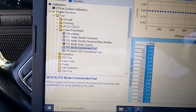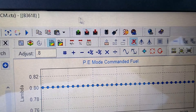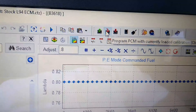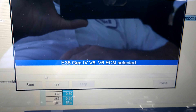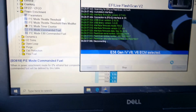So first, get the rev limiter up to 6,000, then do your spark tuning, then do your performance enrichment. When you do that, make sure you have some kind of scan tool. HP Tuners is an awesome product, EFI Live is an awesome product, Aeroforce Gauge is an awesome product - use a Bluetooth adapter, whatever - but you've got to be able to monitor the results. If you just blindly start throwing spark and fuel into it without knowing what's going on, you could turn your engine into a grenade. Both EFI Live and HP Tuners have really good scanners built into them.